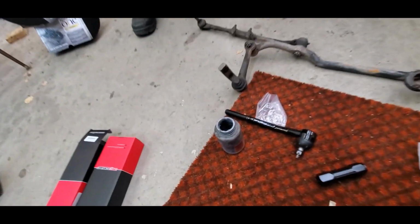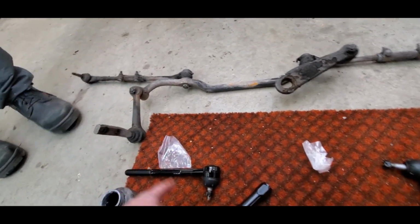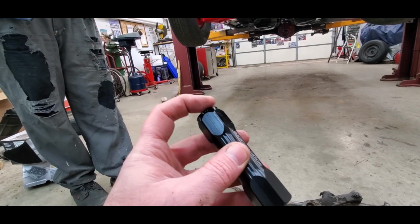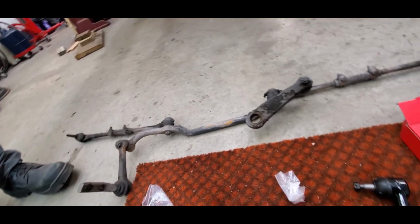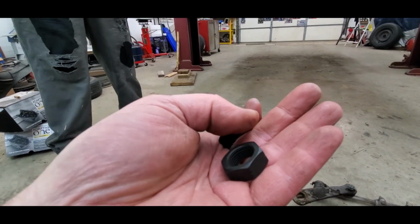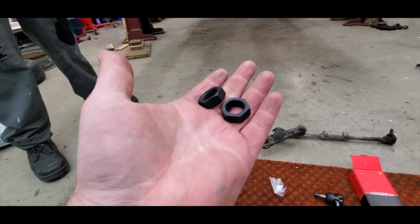Do not forget to use your anti-seize on these. And then remember, one nut's going to go backwards. In this example, it turns out it's the inner. A lot of times something will be marked. Like, see how this one's squishy? That's showing that that's left-hand thread. And I lost the nuts for this. Oh, Harlan's got them. And then see how one is just a regular nut and one has little nicks in it? That almost always means left-hand thread. So just things to think about.